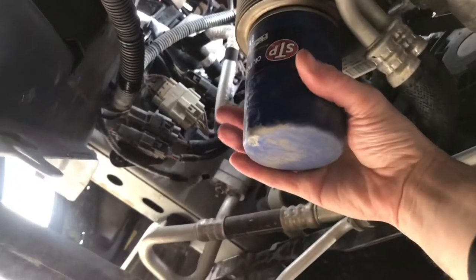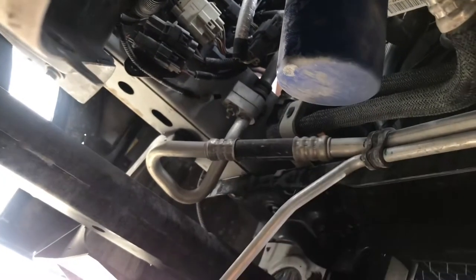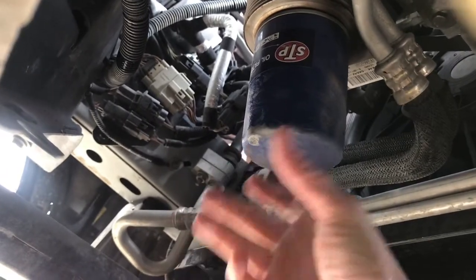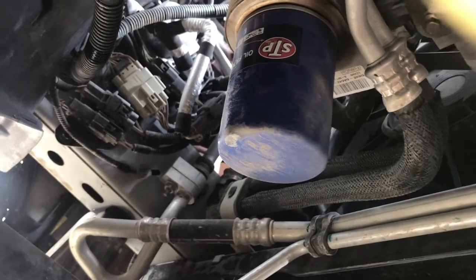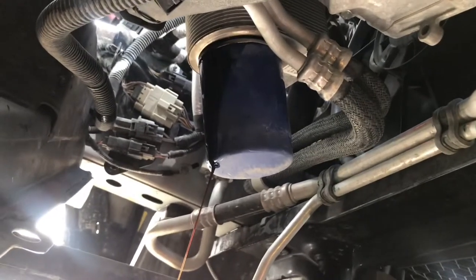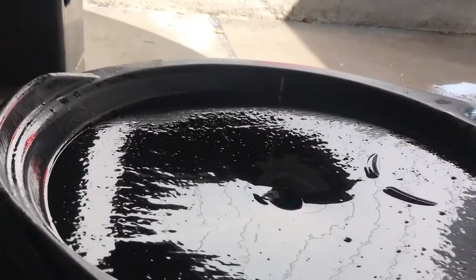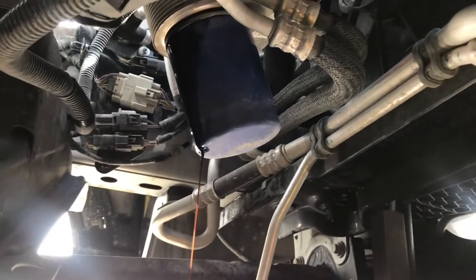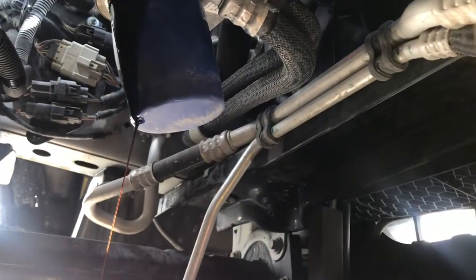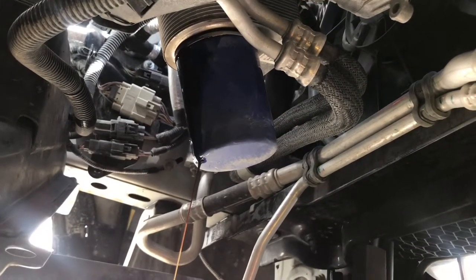Now onto the oil filter — this is the old one. I was just turning it with both hands and you can get this off with both hands. I'm going to move the oil catch can right below it so it catches all the oil that comes off. I got the filter loose enough to where the oil is dripping out of it — I think this is the way to make the least amount of mess. I'm just going to let this drain right into the pan until it stops, then unscrew it all the way off so it won't splash all over the concrete. I'll let it drain for four or five minutes and then go further.